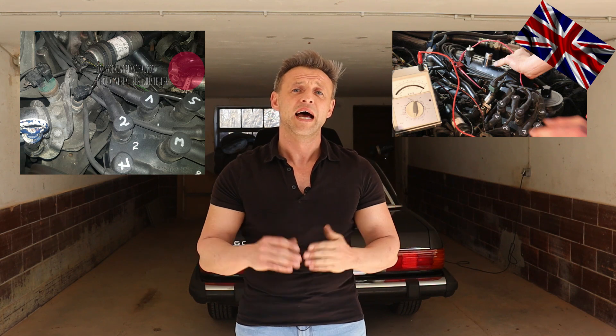You will find it right next to the cold start valve — it has a socket with three poles. This TPS transmits signals to our control box CPU, telling it how far to open the throttle and change the fuel and air mixture. Engine powerless, engine stalls, stumbling and rough running — a malfunctioning TPS could be the cause.